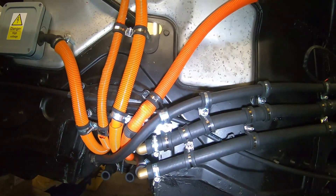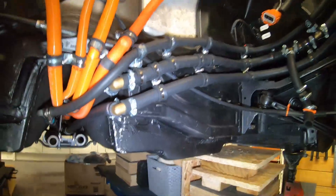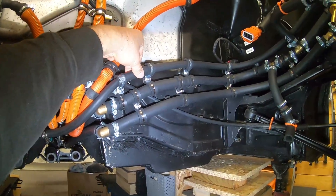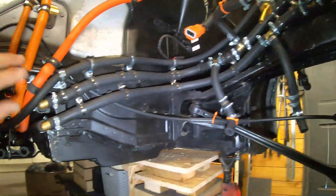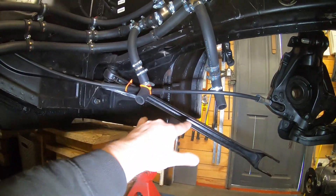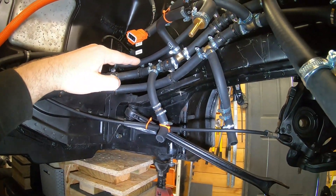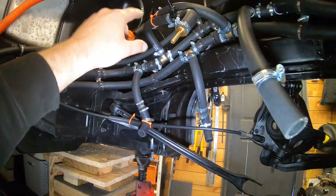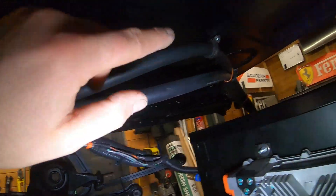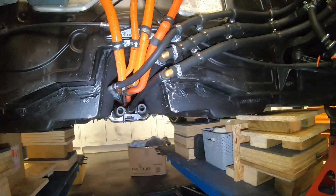This cable here connects to the charger, and at the front of the car is the Type 2 connector to plug into the wall. Here is the cooling system I've made for the battery boxes — this is the original breather pipe the Boxster had, which connects up to the expansion tank. We have coolant pipes in and out: the bottom two go to the lower box, and the top two — I've got some bleed valves — go to the top box. Each box has one coolant-in and one coolant-out pipe connected to it. This connects to the LDU, and these two pipes up here will go to the battery box I'm going to have under the boot, which isn't ready yet — so I've just got them prepared. There are lots of hose clips and P-clips, and I'll tighten it all up before installing the subframe.